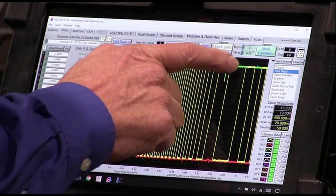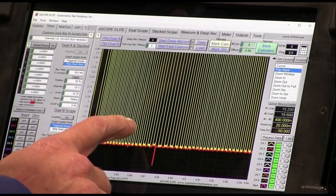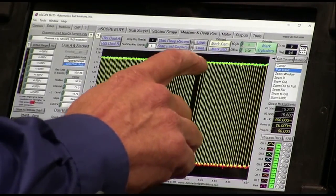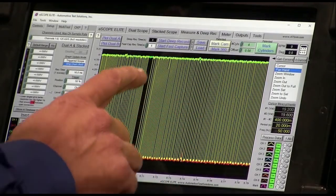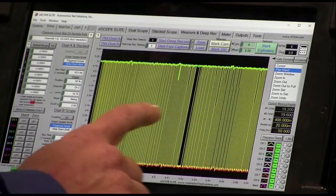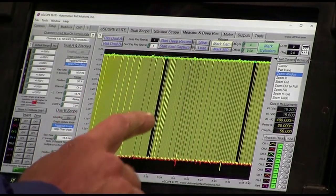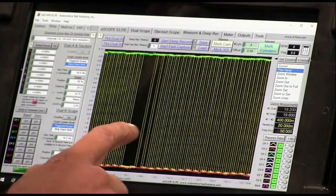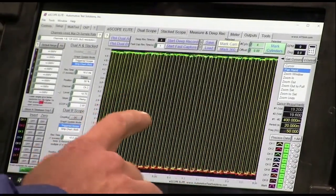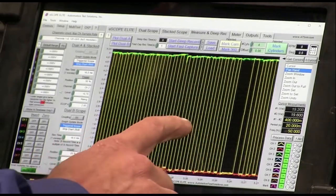Look at that strike right there in the 5-volt signal striking down. That looks like an ignition hit there. And look at the ground getting that strike there. Again, that looks like an ignition. And right here, this looks like a pretty wide opening for the second one. Let's see, I guess maybe that's the way that is. But that seems like too wide a tooth right after my gap. I've got ignition strikes all over these powers and grounds on the sensor.